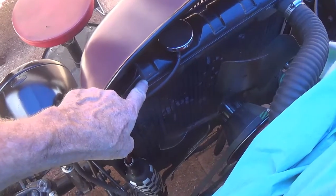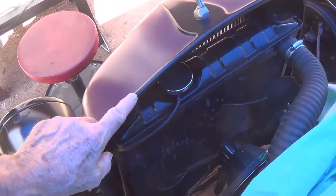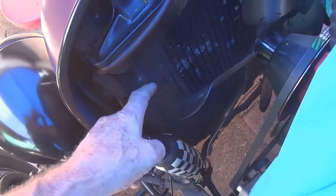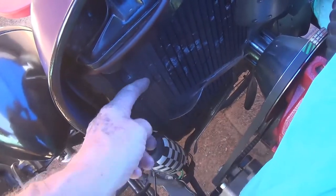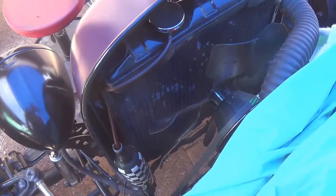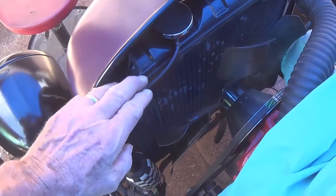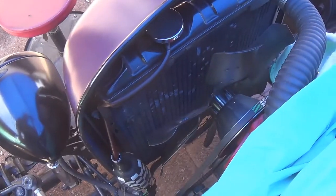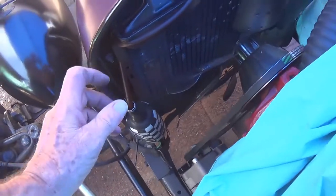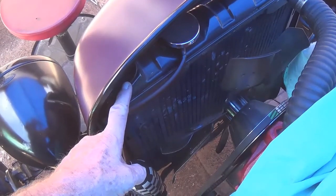The next job is to replace this radiator. The 64-65 Ford Mustang radiators fit perfectly in these grille shells. In this case, this one was installed crooked. And when they ran the little plastic rod through to hold the fan, they damaged one of the little tubules so that the radiator leaks. I've got a three-core aluminum radiator I'm going to replace it with. Step one will be to remove the grille shell, then this kind of hideous bottle — I got a really nice polished aluminum overflow tank — and then we can drain the radiator and remove it.